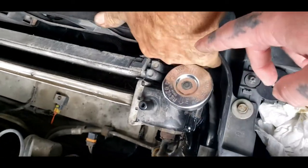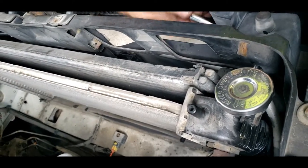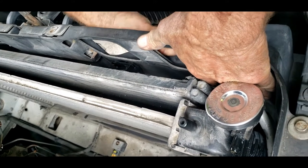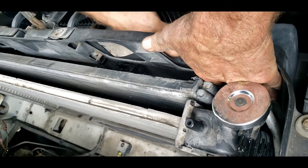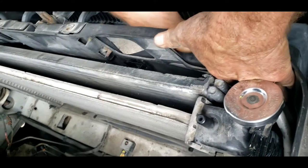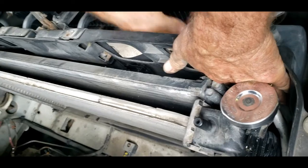There's a 10mm on this side and a 10mm on that side. There's a cutout right here on these things to make it easier to get to - that's for your condenser, cause it bolts to your radiator. If your car's got nice cold AC and you don't want to damage the condenser, be careful.